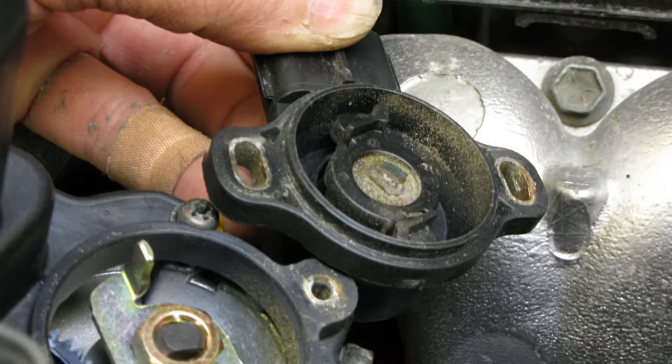If you don't want to spend money on something that might not be the problem, the first step I would take is to pull the throttle position sensor out and clean it. These sensors sit right next to the throttle body and are therefore prone to all of the dirt and water that an engine experiences. It's possible that you just have a faulty connection, or there is some dirt, oil buildup, or grime that is not giving you a proper electrical connection. While you're at it, also check all of your electrical wires to make sure you don't have a bad wire or cable.